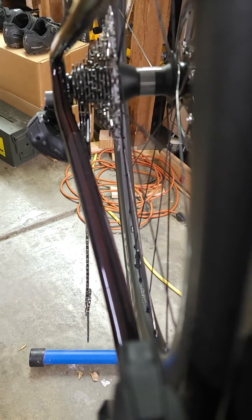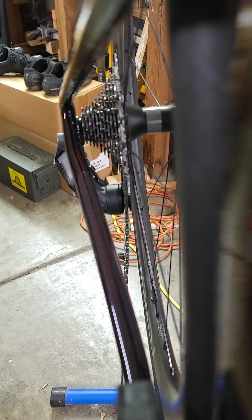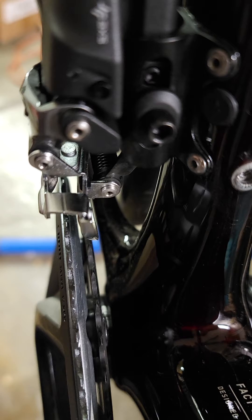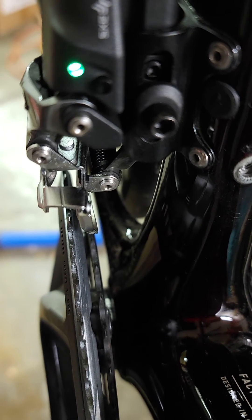Now, again, let's get into the low gear — because we've got a hill or something. We're just cresting the hill, and hey, let's put some power down. Now, granted, I'm not typically supposed to cross-chain, but this is even an issue there. And let's go a few gears up, which is usually about where I'm shifting in the large chain ring from there. So let's go back to our large chain ring — let's get this alignment, which is perfect. Let's shift to the lower, then shift to the big chain ring.